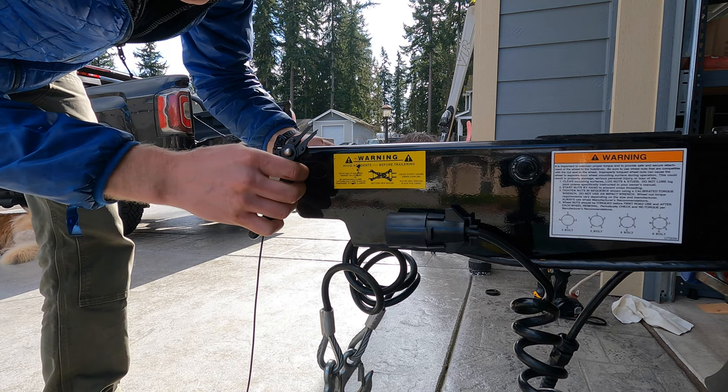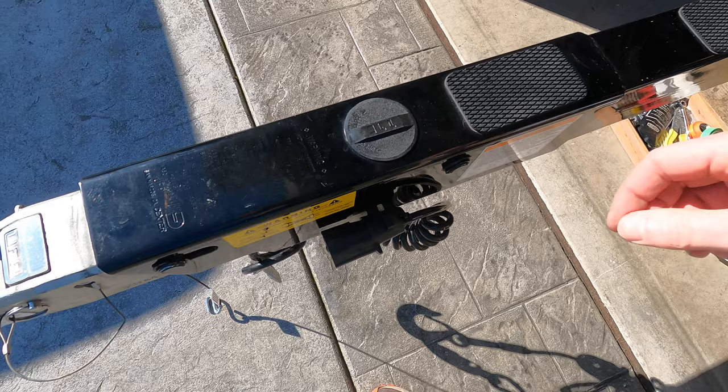Make sure you get them in the channel — this one's not — here we go. Good to go there. Alright, now with the head in, we've got a couple things to do: we've got to hook our positive wire, our blue wire up — and that goes there. This white wire gets screwed in into the solenoid up there, and then the brake line goes into the back here. Can't really video this and show you, but this fitting gets back up into there. I'm going to get that done. Got my blue line back together, got the brake line in the solenoid and the white one on, and then this back on here — that's everything under here.